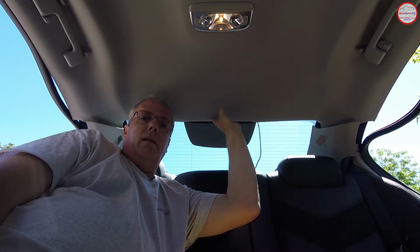So we got all the things in place that we need to have in place before we button it up here, which is pretty straightforward. So I'm going to go through those steps now and speed it up probably in editing to make you less bored while I'm doing it. But the simple parts are: one, confirm that the wire is out of place, which we've done as far as the clips. Then you're going to push the headliner up to get the clips engaged. And then you're going to put the headliner up on the edges. You can put the door seals back into place to help hold it up. Put the screws in for the grab handles. Put the C-pillar trim back in place by snapping it into place. There's a couple snaps on the upper end. And then put the screw in place and put the caps back in place. And you're done. So let's get going on that.